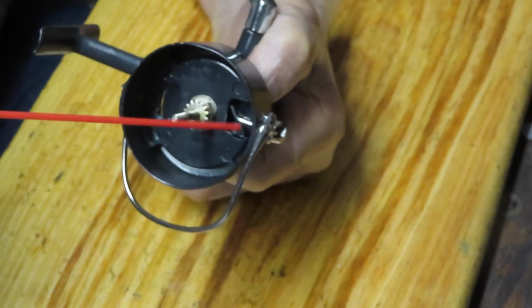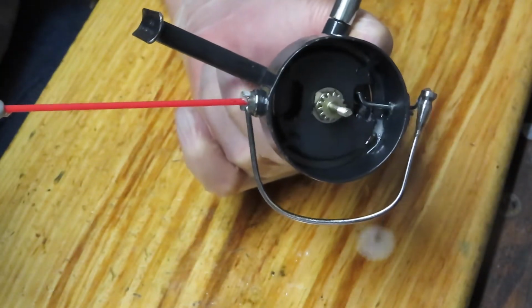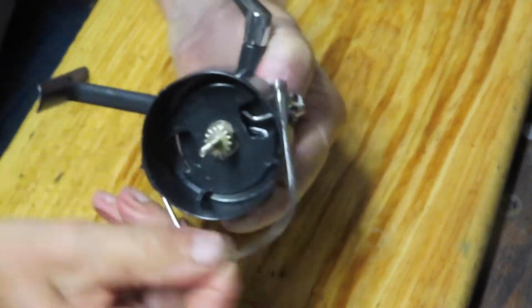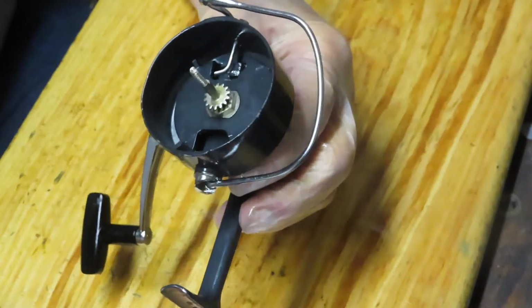So there's nothing to do maintenance-wise here. There's no springs or anything. All you want to do is make sure that the circuits, where it travels, those two pivot points on the spring, work nice and free and easy. And the best way to do that, just use some penetrating oil to free it up.